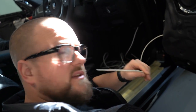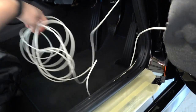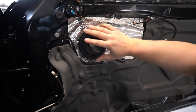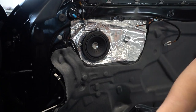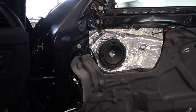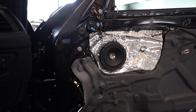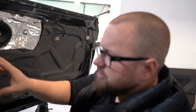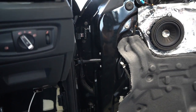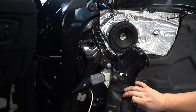This is a lovely speaker cable — expensive, but nice. We could run either our mid-range or our tweeter, but we'll probably run the tweeter from there. We already have a cable in the door that we can pick up elsewhere in the car that will run the mid-range actively. We just want one in the door because any more than that and we start to stress out the grommets and stuff. As you can see, this is all OEM now — there's no compromise there at all. We tie that in inside the door and then off we go.